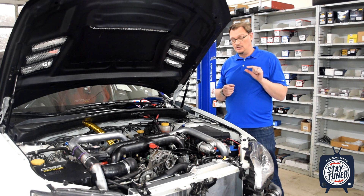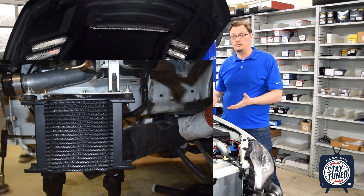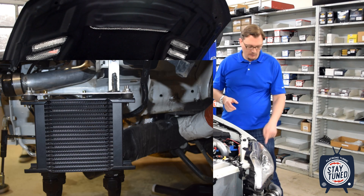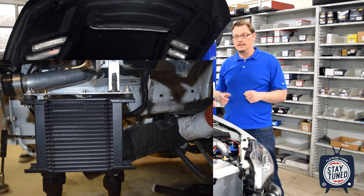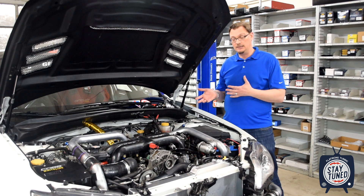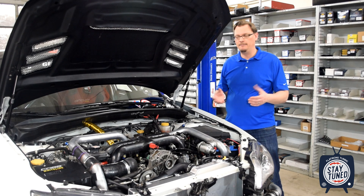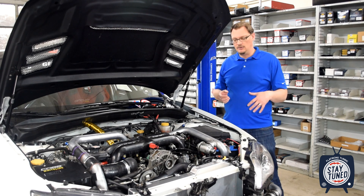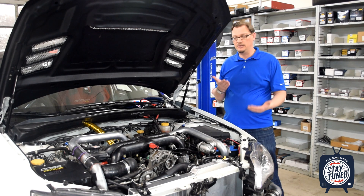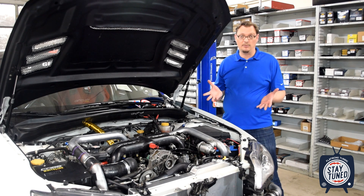It's also worth mentioning that Roger Clark strongly encouraged us to put on an oil cooler, so we've done that as well. We've got an oil cooler fitted here. We weren't really concerned about oil temperatures because of the volume of oil we're running in the tank and because it's placed in a cooler environment in the car versus in the engine bay, but they really recommend putting a cooler in place. So we've done that too, just to help keep oil temperatures in check and where we want them to be - that should also give us more reliable performance this year.